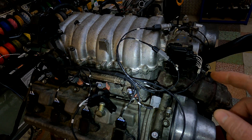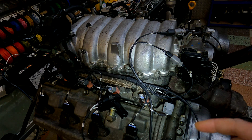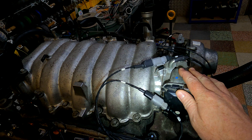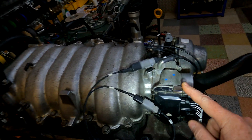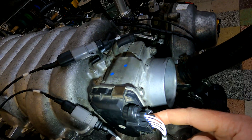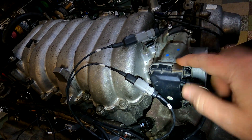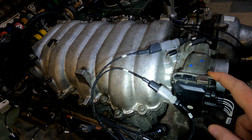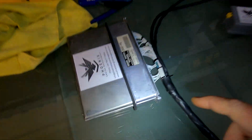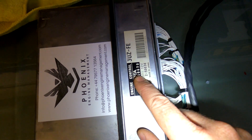So I spoke to Calvin over at Cartoon, Brandon in America, and Yuri over in Russia. The 3UZ 6-speed throttle — you can see it has a 6-pin plug, not the 4-pin and 2-pin. So these work on a standard 3UZ 5-speed ECU without any dramas. We've got this whole thing hooked up — part number 89 double 6 1 5 0 6 7 0.